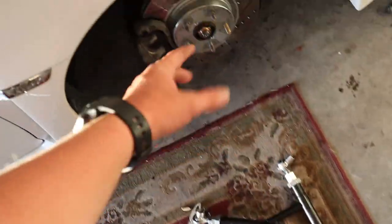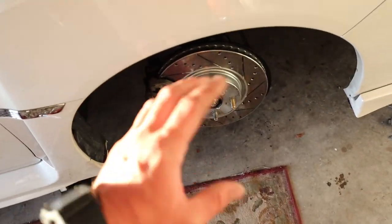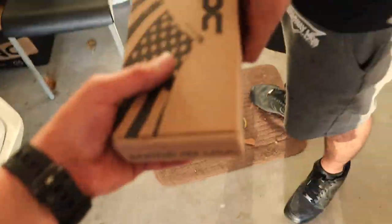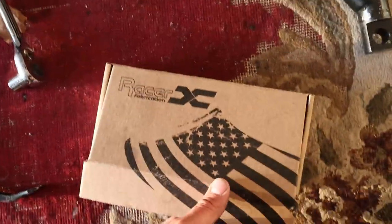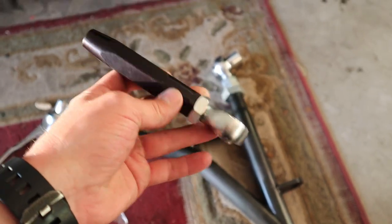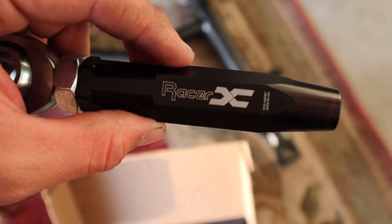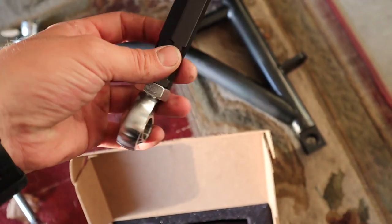From there, pretty much everything is gonna be brand new with the lower control arms, because you're gonna be pushing out the bottom of the wheel so much. This is gonna be the same if you're just extending your stock lower control arms. You're going to want to either extend your tie rod ends or get these adjustable tie rod ends. I don't know many other brands. I didn't even know they made these for, I guess they make them for Subarus, but these are RacerX, high quality. So far, at least, they're super nice, kind of on the pricey side, but very pricey,